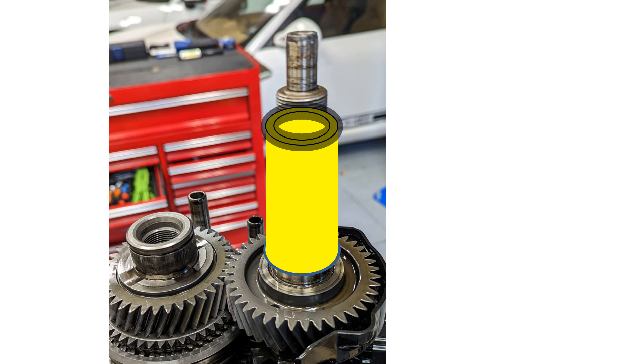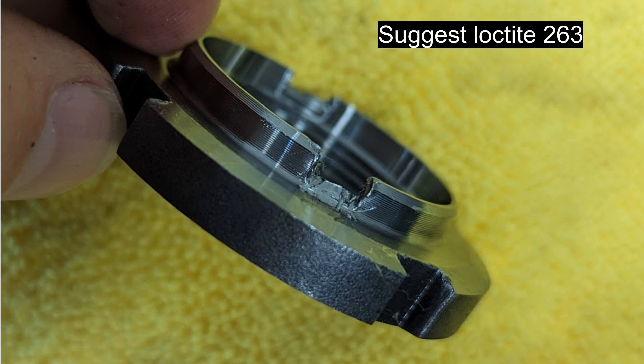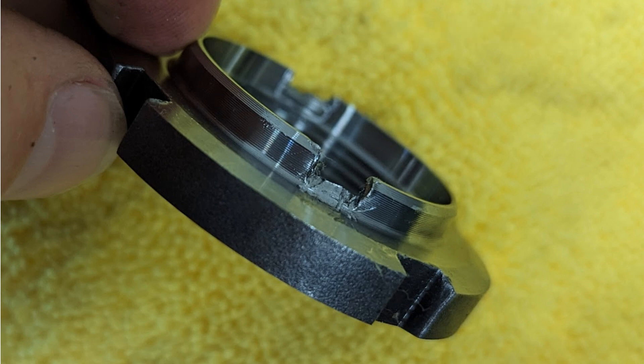While tightening this down, also tighten down the bolt on the other shaft in exactly the same way as done on the 981 or 991 two-wheel drive version shown in the other videos. You need to progressively pull these down evenly, probably half a turn at a time each, so the rear casing gets pulled on as evenly as possible. If your transmission has the slotted nut and the tabs are no longer any good, find the strongest Loctite you can get and apply that prior to installing the rear nut.